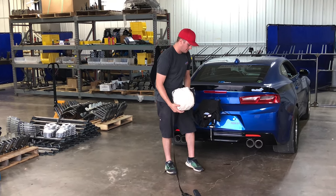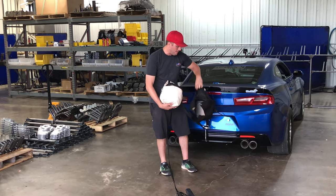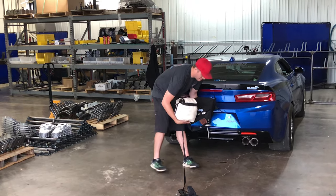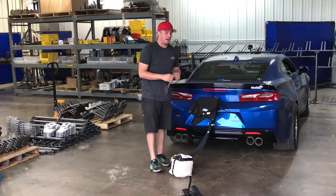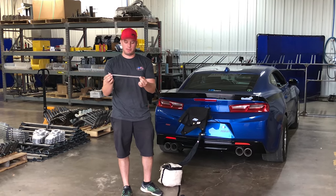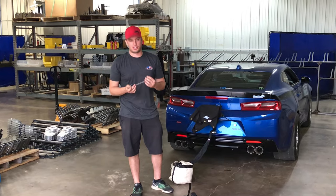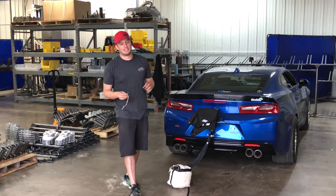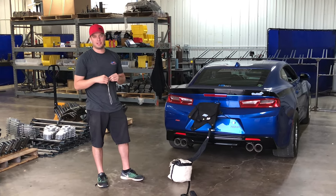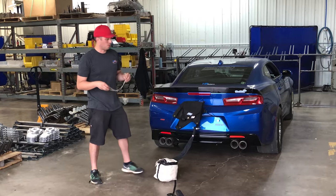We're basically at the point now where we can start putting it actually inside of the main pack. The main pack is the black one I talked about. One thing you need to remember is when you get your parachute, it's going to have this little white string on it — don't throw that away. All I do is take this, loop it around the back of the parachute, and put it on there. It can ride down the drag strip with you and you're going to need it. Packing the chute without this is a huge pain. I'll also put a link in the description for a three-pack of these — if you lose one, it's always nice to have a backup.